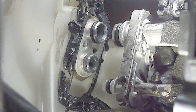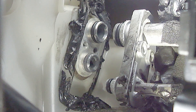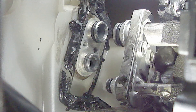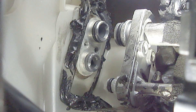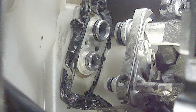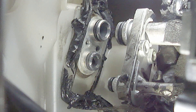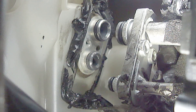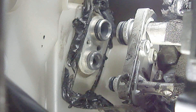This is kind of difficult to film and get the right lighting, but the expansion valve was located here over on the left side, which I've already removed. You can see the four separate AC lines that were attached to the expansion valve. This did not require the removal of any of the dashboard or any of the airbags. Before removing the expansion valve, you'll first need to have an auto repair facility remove the refrigerant.